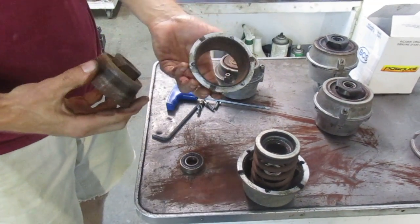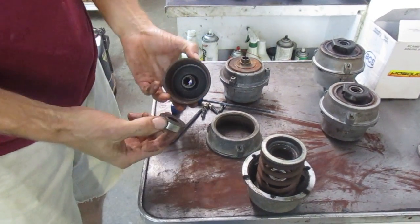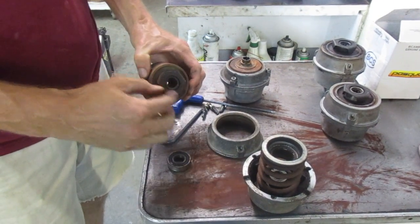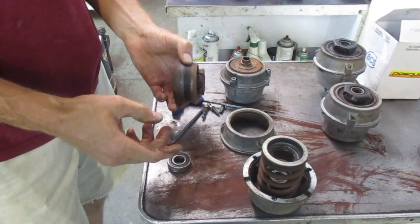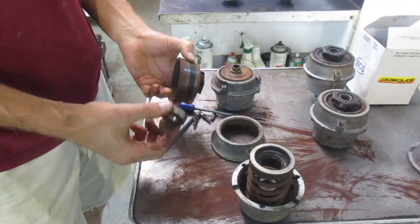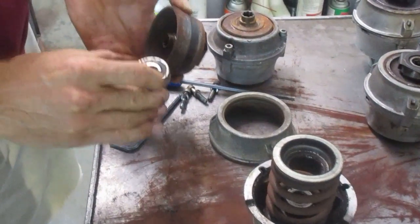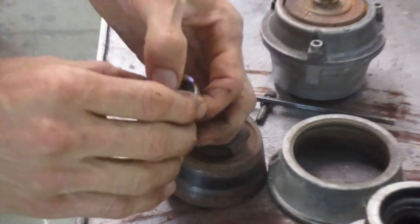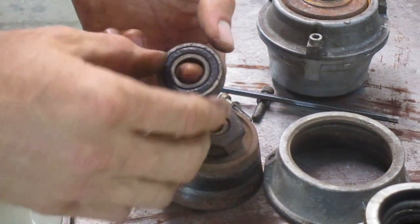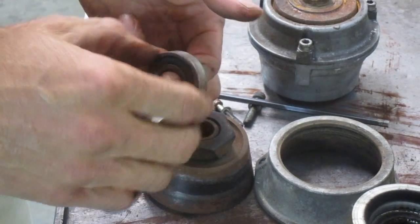You've got the inner cone of the clutch and the outer lining of the clutch. Two bearings in the clutch: an inner throwout bearing and an outer throwout bearing. The most common problem that goes wrong with these clutches is that one of the throwout bearings goes bad. These are just sealed ball bearings with rubber seals to hold some grease in. After a certain number of years, the seals go bad, the grease comes out, and the bearings dry up and cease functioning properly.